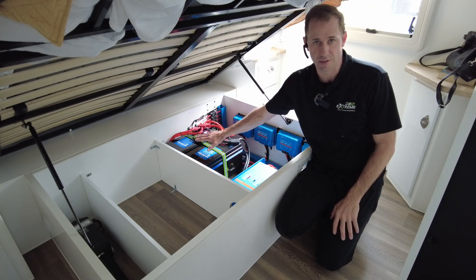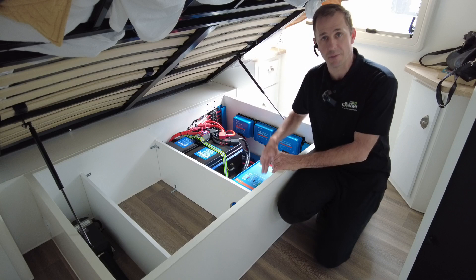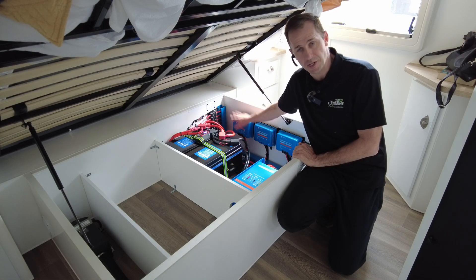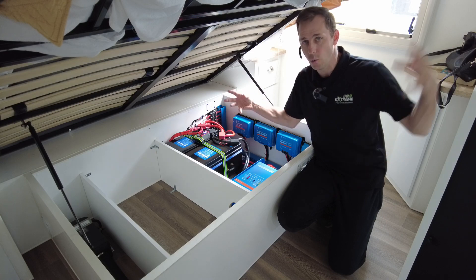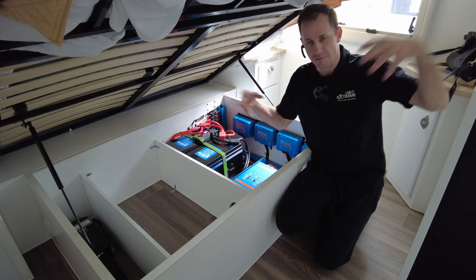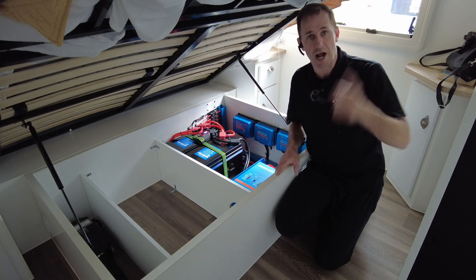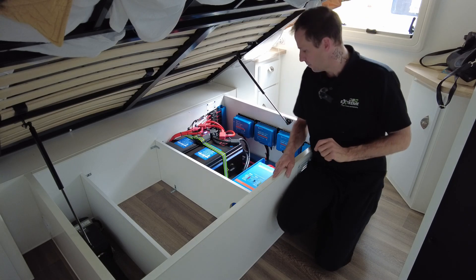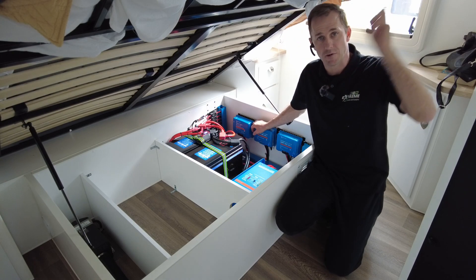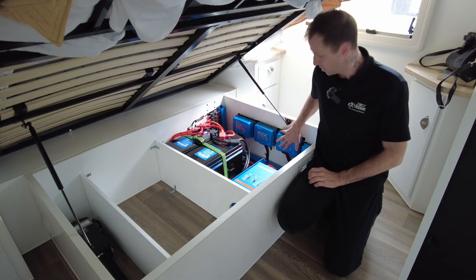To recap: 560 amp hours of Powerpall lithium — that's over 6.7 kilowatt hours. We've got the Victron Multiplus 12/3000/120 inverter charger running all the factory outlets including the air conditioner. We've got the Orion DC-to-DC 30 amp charger for vehicle charging on top of the solar. So there's about 360 watts coming in from that, and over 1,060 watts from solar — nearly 1,400 odd watts going into these batteries simultaneously while he drives. If the sun's up, that's enough to charge the batteries and run the air conditioner at the same time. We've got the MPPT 130 taking care of the original factory 400-odd watts of solar on the roof.